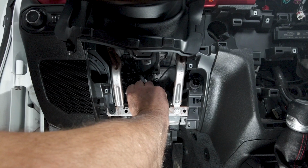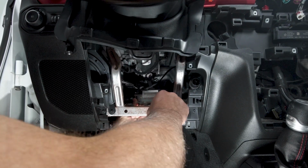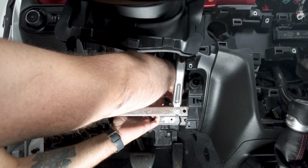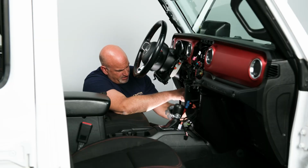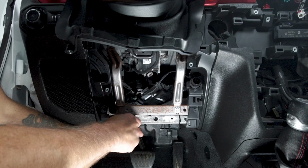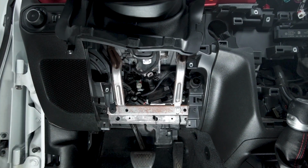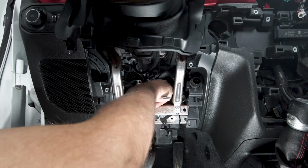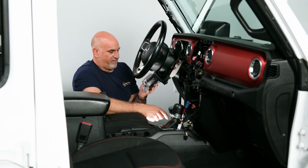This will actually become loose. So now we just need to be able to turn it to unplug the connector. So we have 1 set of wires attached. We just want to get that off of our bracket. There we go. Okay. Once you've removed that, you can actually remove the plug in the inverter, pressing down and pulling out. And then we'll actually remove the whole inverter from the truck.